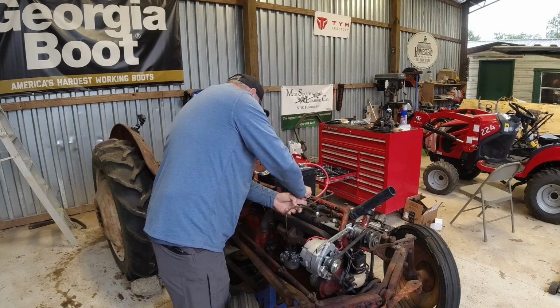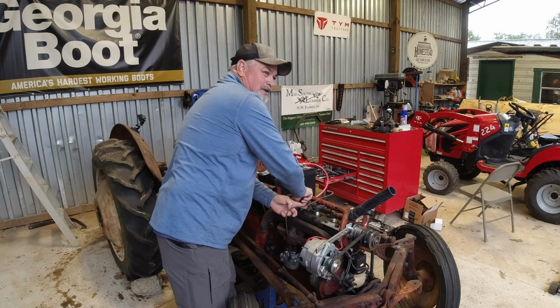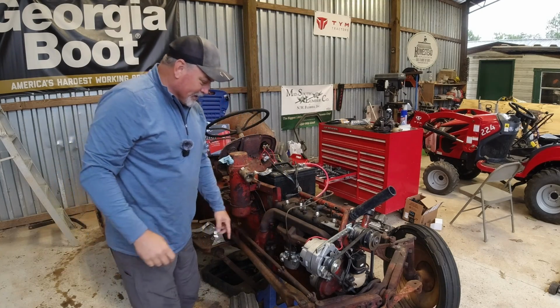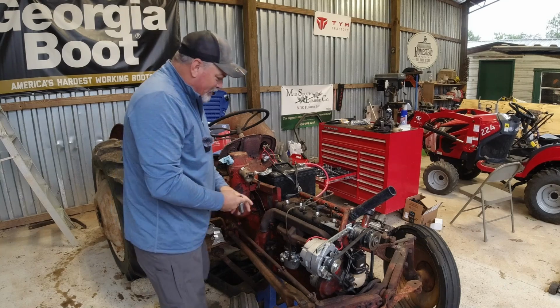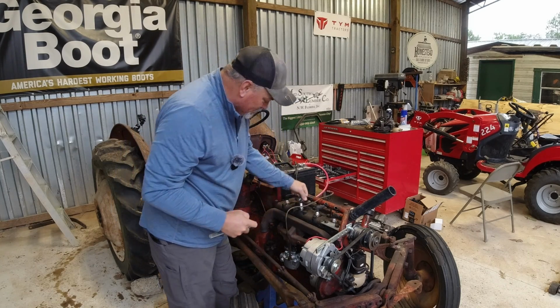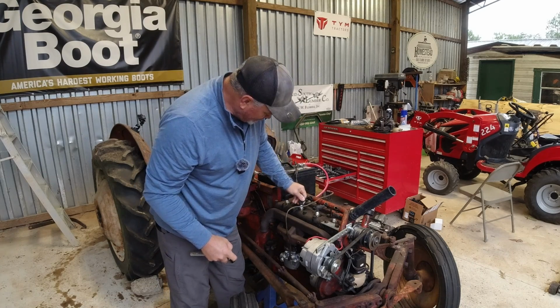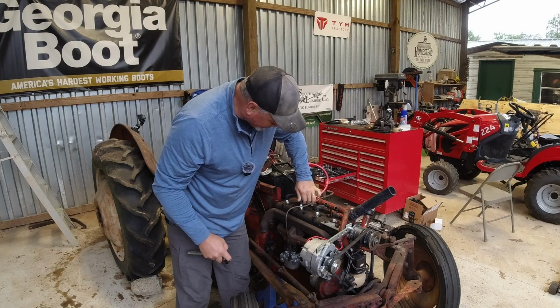Yes, sir. All right. So we got spark. So we need fuel, which we're going to do, air, which we got plenty of, and compression. And then the only thing we have to worry about is if the timing is off. But like I say, we're just going to crank it up. And once I know that it cranks up, then we'll go to oil change, we'll get the filters changed.